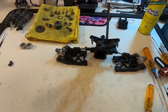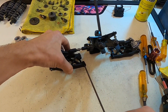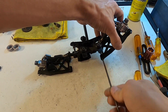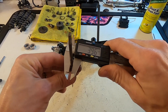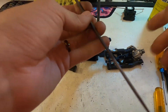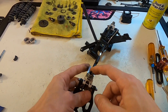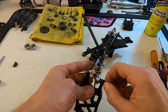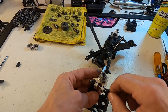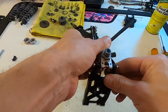As the diff is still cleaning up, go back and wipe down the hinge pins — make sure they're all smooth and free. I have a chainsaw file that I use into my arms as my reamer. You can obviously use a regular reamer; this chainsaw file is about 3.95mm so it's essentially a 4mm chainsaw file, and it's actually wearing down a little so I'll need a new one soon. Also make sure — depending on whether you're using the plastic or aluminum piece out here — the aluminum one has set screws tightened against the pin so it doesn't spin. Make sure the action is all smooth.